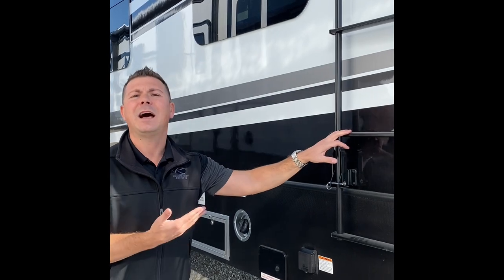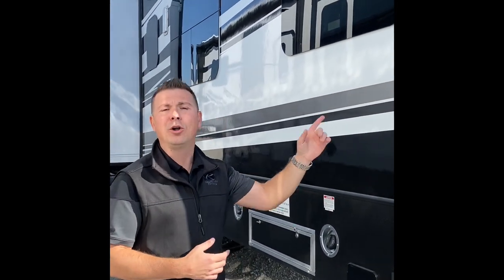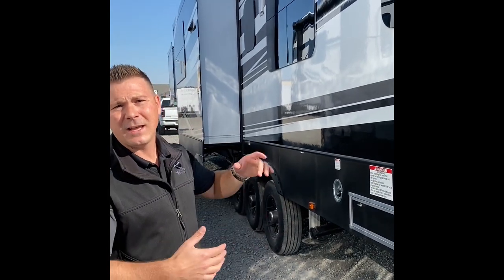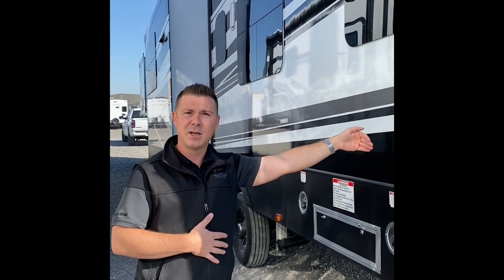This ladder is gonna allow them to do that, so it's not an option. But on top of that, all of the roofs are gonna be fully walkable. The slide boxes will be fully walkable, and we will use 5-inch wood trusses. So 5 inches in the center, tapers down to 2 3/4. And then they will be 16 inches on center. And then the roof will have 3/8 plywood over the top of the roof trusses so that you can get